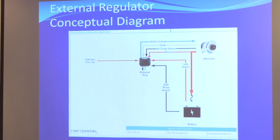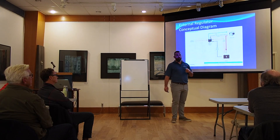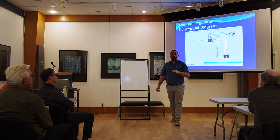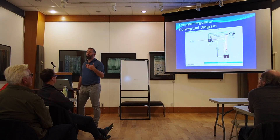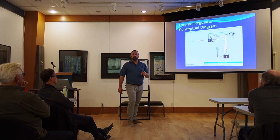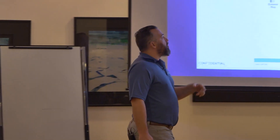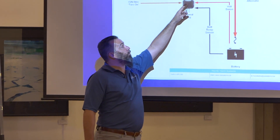And that's the thing you actually want to measure — is my alternator being told to work? Full field means whatever the battery voltage is, 12 volts, you see 12 volts on that wire. As the battery gets fuller and fuller, it starts throttling down. You might have problems with your temperature sensors. If there are dead shorts on those, they might think the battery is overheating and stop the alternator from outputting — what's called thermal runaway. That's why laptop batteries catch on fire when charging.